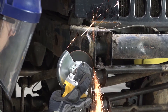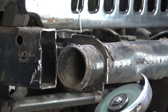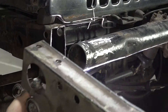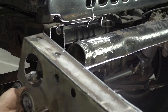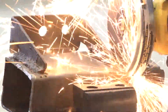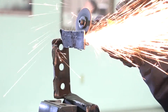Step 4. Begin cutting away the material around the front crossmember so that you can gain full access to it. Grind it down until it's flush with bare metal. Cut away the section just inside the drawn line while avoiding damage to the sway bar bracket. Once the mount section has been removed, remove the sway bar bracket from the remnants to be used in a later step.